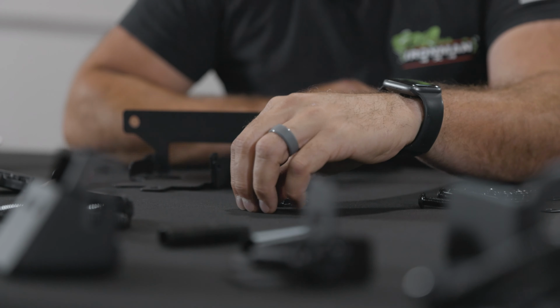All right, let's go up top, pop your hood. We're gonna pull this whole radiator top plastic shroud piece off. I start down here because you gotta pull this air intake off. So as you pull these clips up, just go slow because you don't wanna break them. All right, so we're gonna do that just down across and get them all out. We'll pop that off. All right, get the last one here. Set those aside. This should pop up and we can snake this guy out.